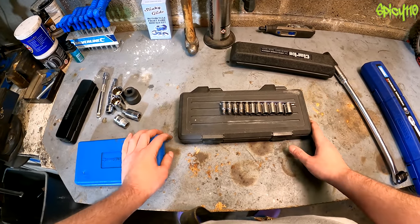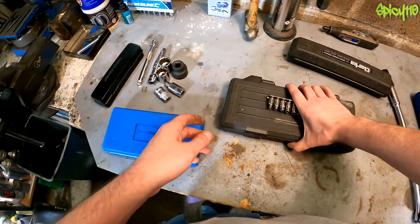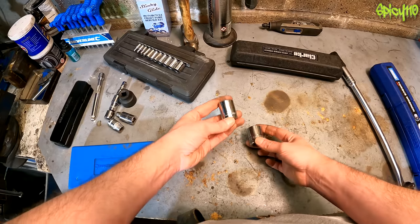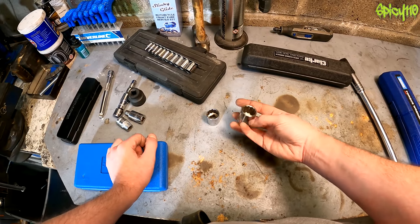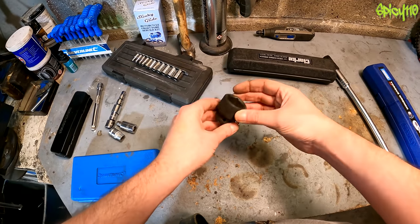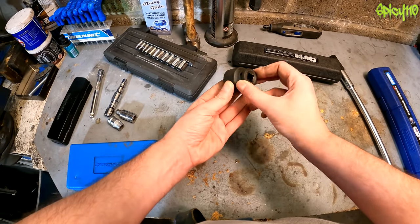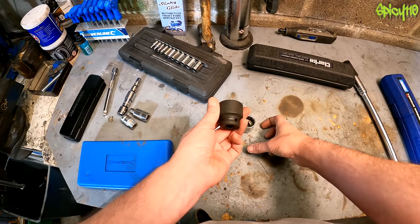This list is really day-one stuff — you're going to need all these things for most jobs. But occasionally, for things like taking wheels off, you'll need oversized sockets. For example, a 22mm for one job, a 24mm for the axle nut on my DRZ, and a 30mm for the front countershaft sprocket nut on the DRZ as well. I don't use those in any other job, so I wouldn't buy a full extra set — just buy the individual large sizes you need.